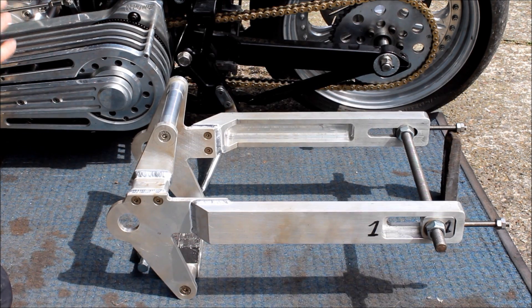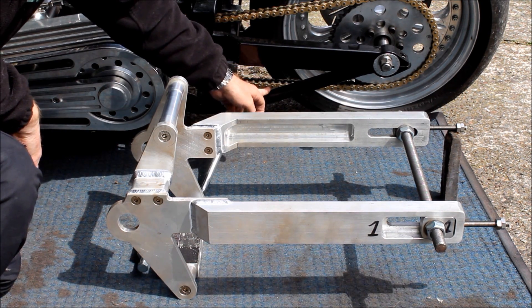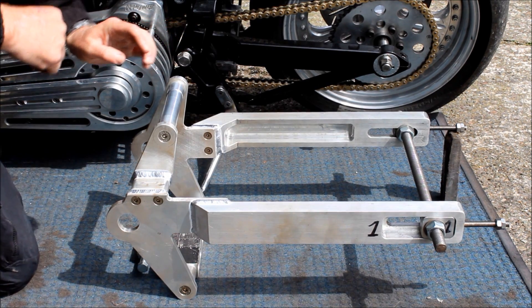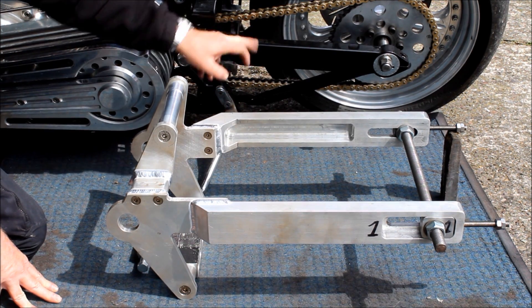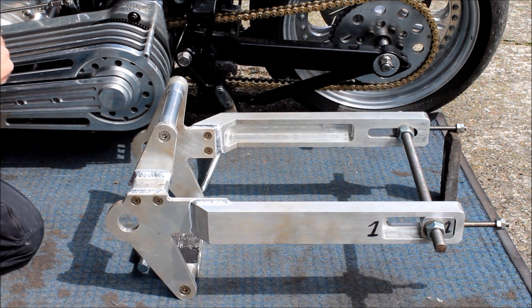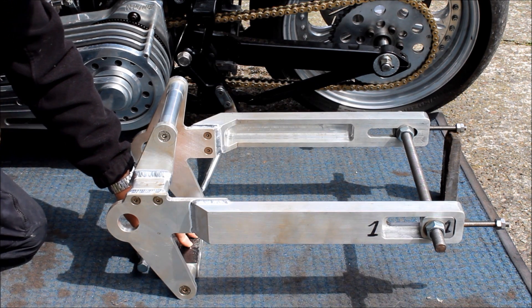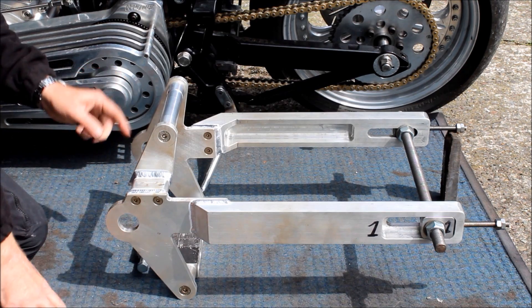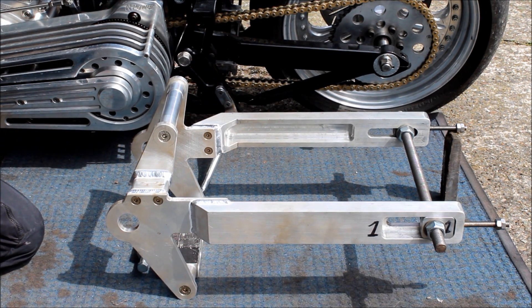Here we are back home and I've got the bike out to do a comparison of the new swing arm against the old steel swing arm that's on the bike at the moment. I'm looking at this under brace here and how we might replicate that on the new swing arm. It won't be quite so easy because we have to make sure there's enough clearance so the under brace doesn't hit this part of the frame. When we modified the swing arm a few months ago we had to put a big notch in the brace area to make sure it doesn't hit the frame. I think what we'll end up doing is an S-shaped brace which comes from down here and does a little S-shape to both come inward and also avoid hitting the frame.